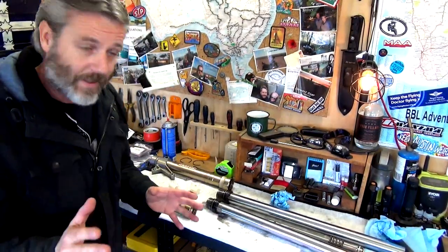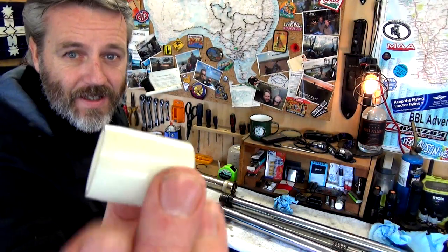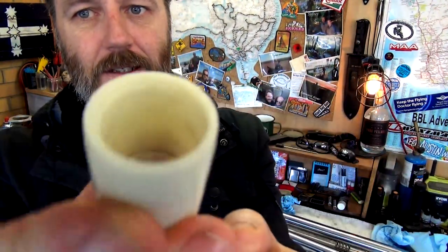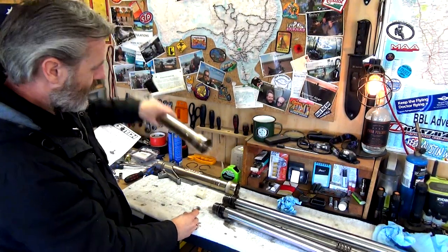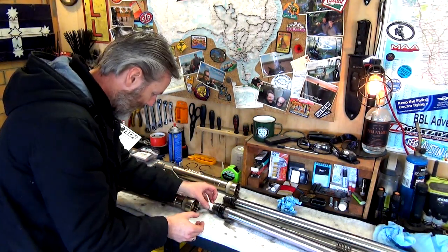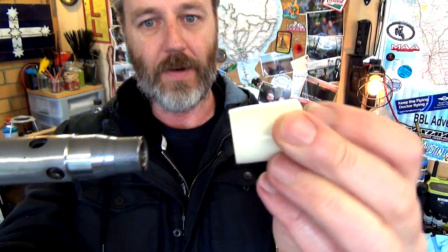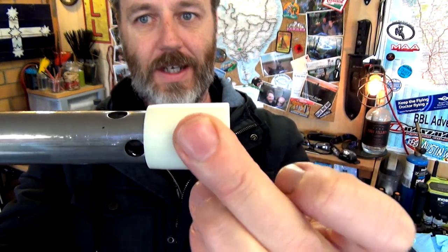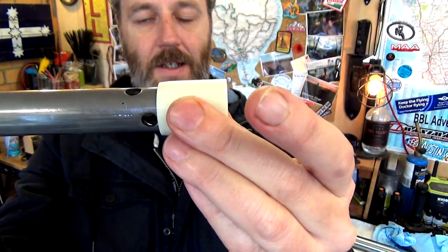All right, guys, I did a whoops, but I've figured it out. When all this came out, you can see, can you see that? So it's different ends. It's actually tapered on there. I looked down there and I went, oh yeah, I see that. And then I popped these out and they fell out, but I didn't know which way they were to sit in there. But if you get that problem, grab your dampening rod, and it's the one where it bevels over, it goes there. And when you do it, it just seats on there. That's the way that it goes in. If you try and do it the opposite way, it's not a neat fit. So I was saved by that one. If you come across that, that's the way it goes.